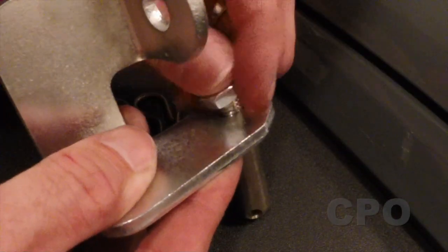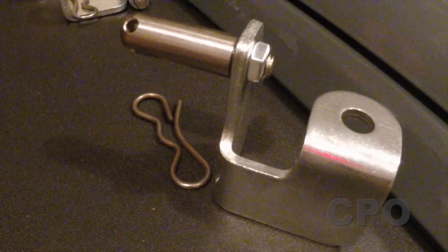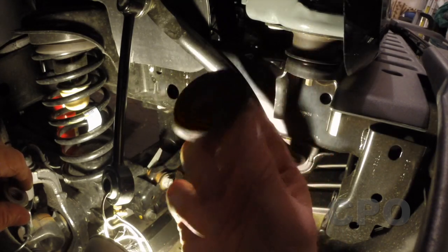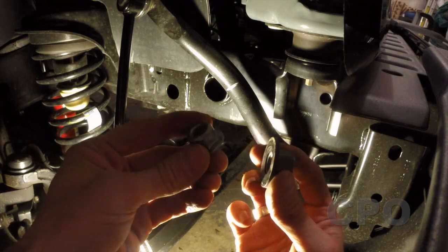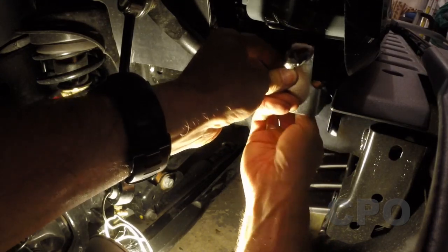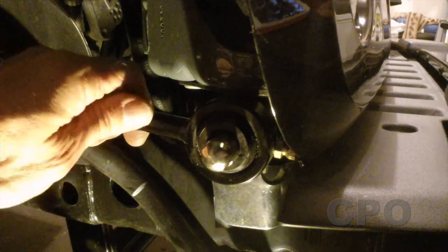So we're basically going to assemble this frame side bracket — it goes together pretty easy, pretty simple stuff. Then remove the nut that holds the body mount. This nut has a built-in flat washer — it's one of those top hat style nuts — and the wide area is too wide to fit up with the bracket. TeraFlex recommends using one of the nuts you removed from the links, but make sure you use the nut from the top link, not the bottom one. On my Jeep, the bottom nut is a different thread — same diameter but finer — so it did not work. Just make sure you can screw it on hand tight, otherwise you'll end up stripping or re-grooving your threads.